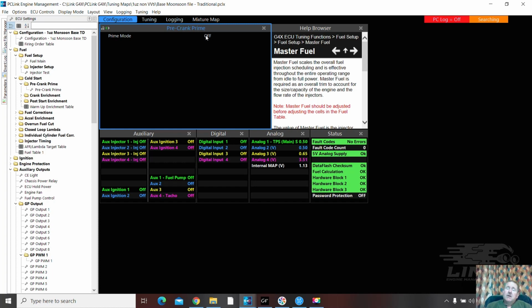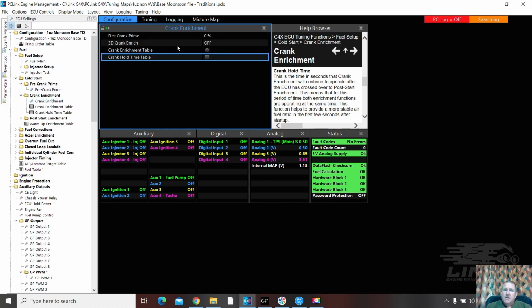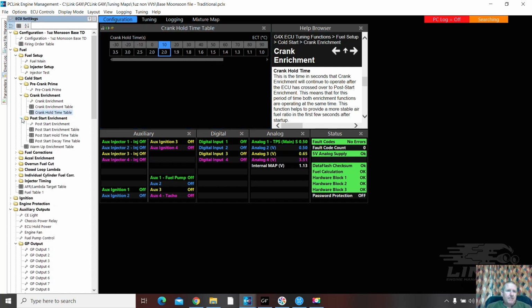That's off. I normally have a start input on a digital input, and then I turn it on to start. If you have this on and people are flicking the key on and off rapidly, you can cause some problems. If you're having some starting problems, you can look at that. They should be good enough to make it run.